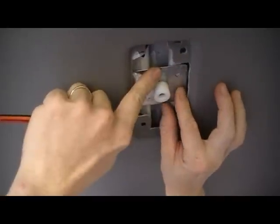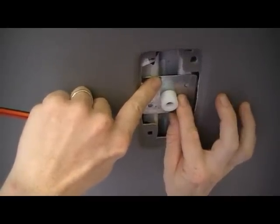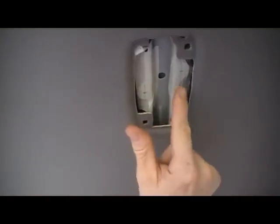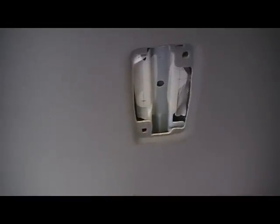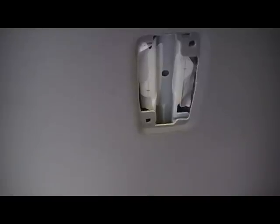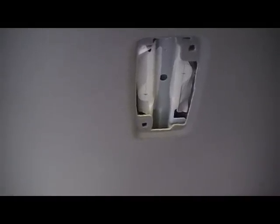I've put this plate on there just to ensure that these markings line up correctly, which they do, and that's how that's going to sit in there. 3.5mm drill hole. It's going to go on each side of this. I'm going to use a vacuum cleaner to pick up the shavings whilst drilling, and obviously ensure that you wear glasses. We'll pre-drill that, we'll mount that bracket, and then we'll go from there.